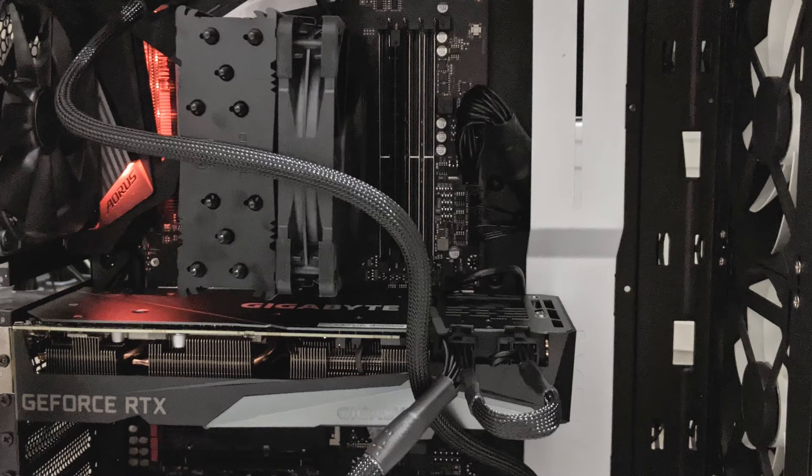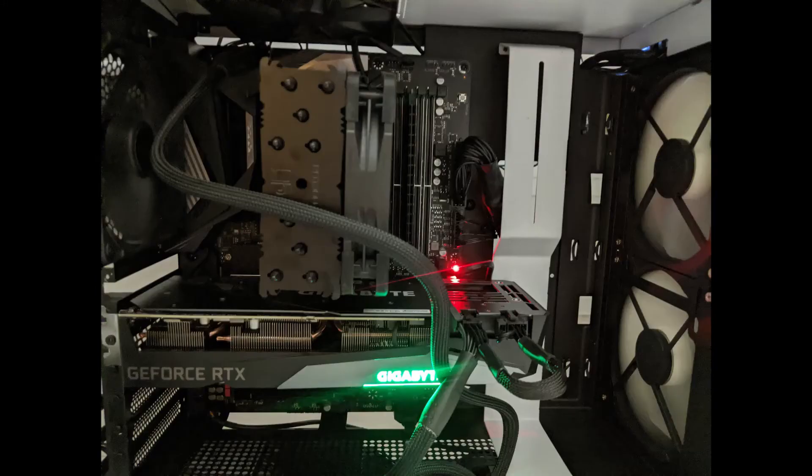Now we can connect in our graphics card, connect up the power cords to our graphics card, and turn on the computer to see what happens. I ended up getting a red DRAM error on the motherboard, which usually means RAM is incorrectly seated — but it wasn't. It's usually because the CPU is really new and the BIOS might not support it. So I had to look up the motherboard's QFlash feature, which allowed me to flash the BIOS without getting visual input from the screen, because the computer wouldn't boot at all.